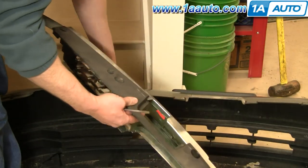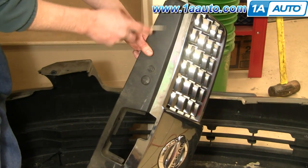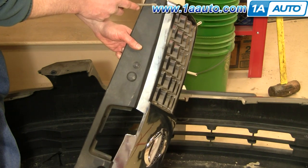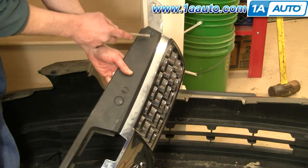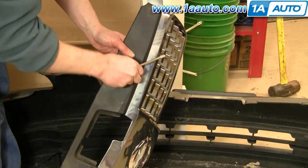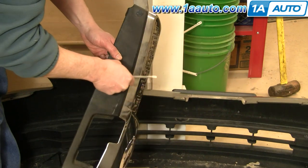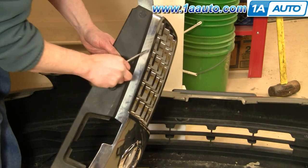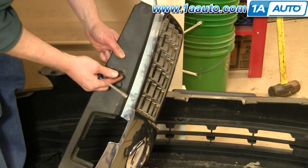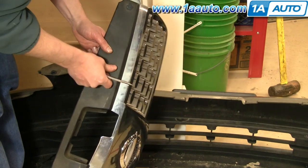My fascia has been broken. Additionally, if you wanted to put a new grille in, you'll want to transfer this top panel over. There are basically just four clips — one here, here, and then on this side as well. These clips are just like the other ones: you pry up the center and pull the clip out. To put it back together, just push the clip in and then put the locking tab right in.